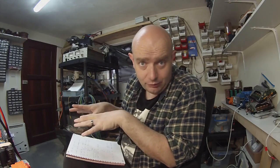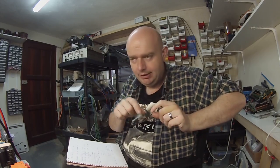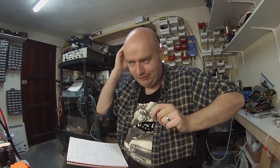We're now able to send and receive messages to the PCS over its IPC CAN, and that's how we're able to send the command message for the DC-DC. It's a little ridiculous in so far as I have a transceiver here on IPC CAN, then two short wires bringing normal high-speed CAN to my Arduino, which has a CAN transceiver going into a CAN controller and changing it all back. It's a bit crazy but it does work.